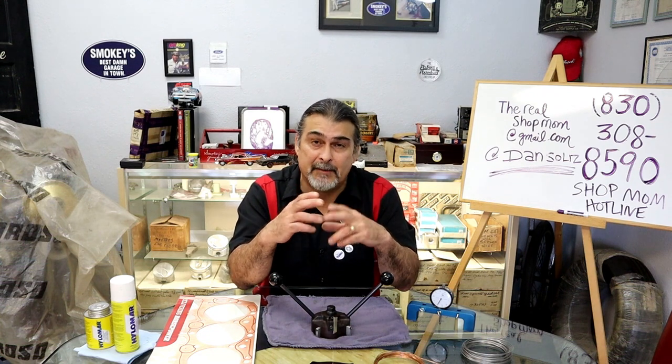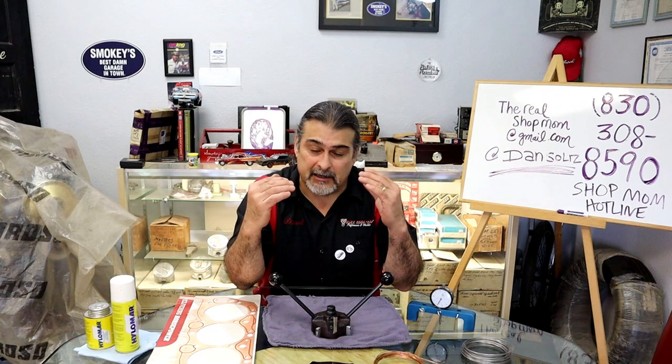All right, the O-rings, the manufacturers want you to put the end gap right at a bolt hole, more clamping pressure there. I do what the manufacturer says, putting them all aiming at one bolt hole. I just suggest that you at least put them all aiming the same place.